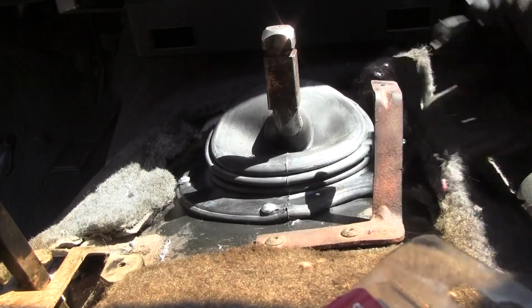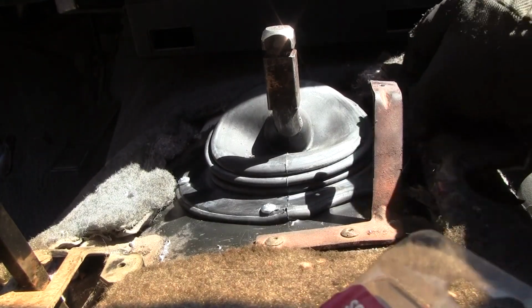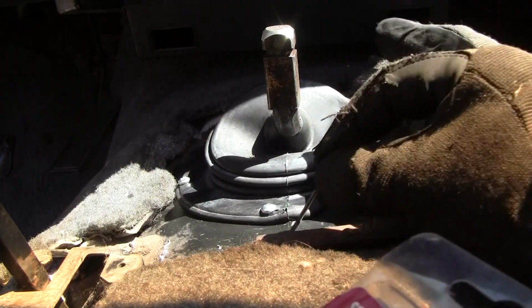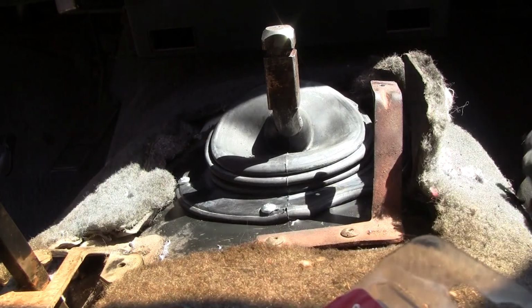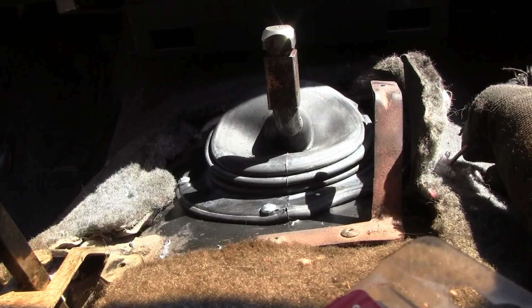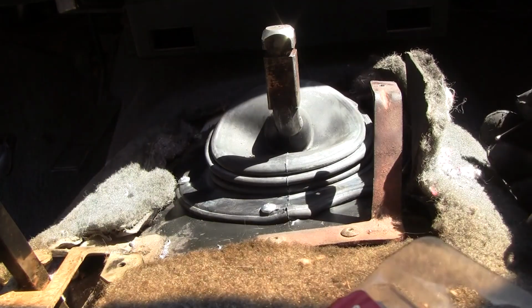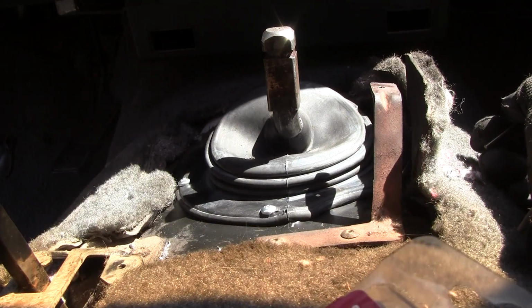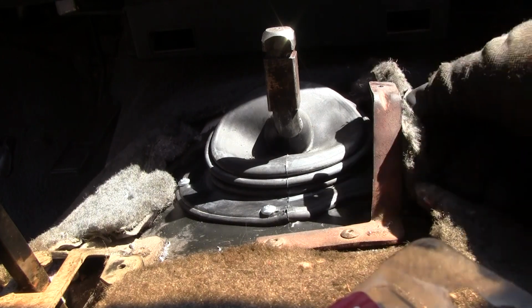So some places to put silicone are this hole over here, hole over there. That one stretched and made the old hole. This one here, and then this one here. Because you really want this sealed. If you pre-drill this, it really would be worth putting silicone, as I've already said, on the bottom of this thing, so then it just seals the daylights out of it. Okay, so that takes care of that part.